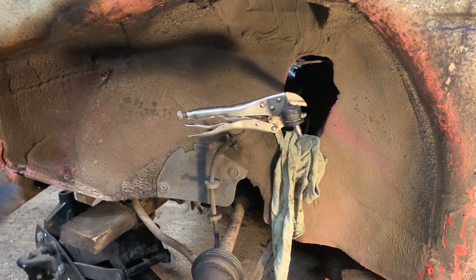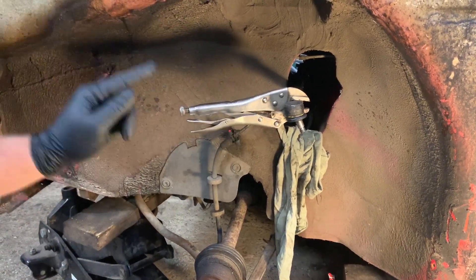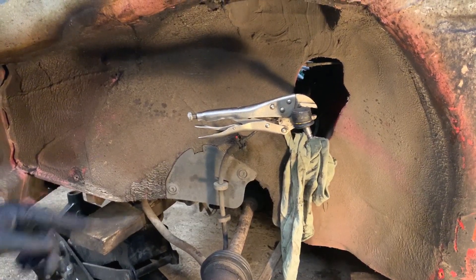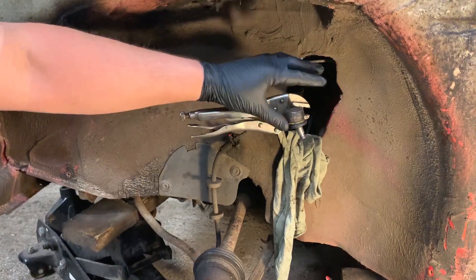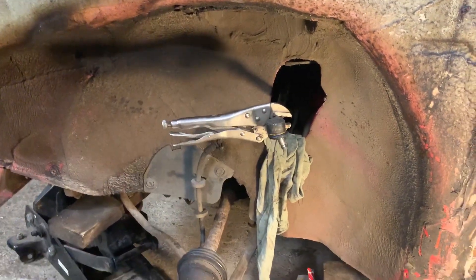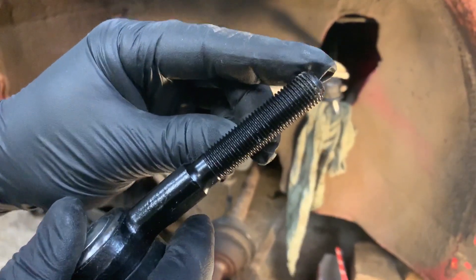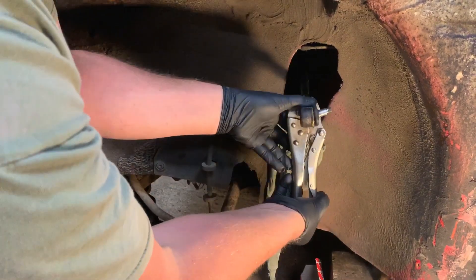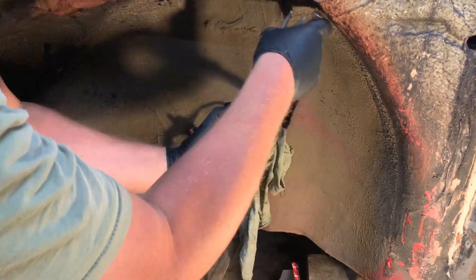I'm back up at the unit ready to put the suspension leg back on, but before I do that I need to change the track rod end. I've actually loosened it, but off camera I had to take that whole bar off and take it to my dad's - he heated it up to loosen the track rod end because the threads were seized. Now it should be loose enough. I did give it a quick paint as well while it was off.